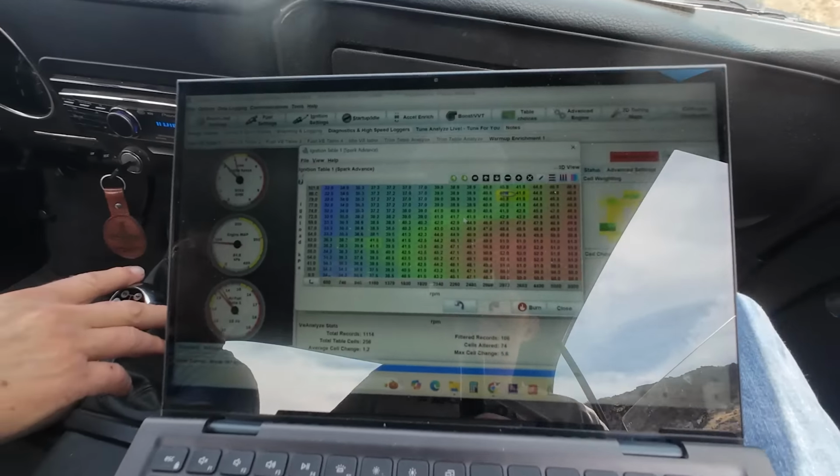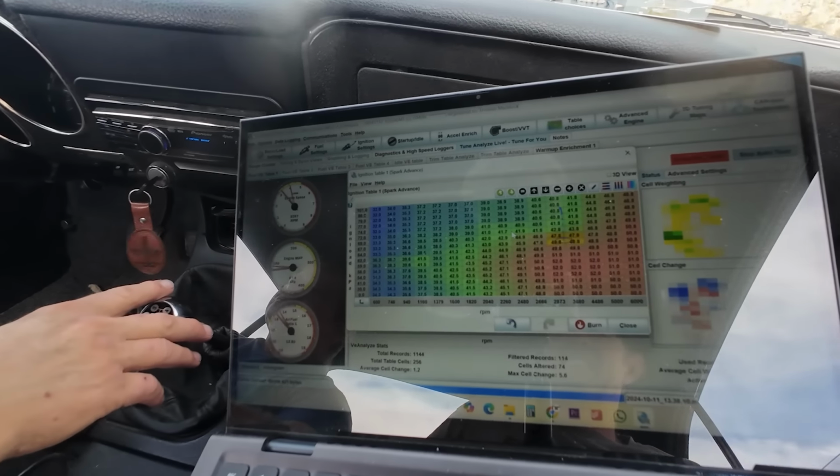Settings while we did that. Now we're going back up the hill again, and I'm going to watch the ignition this time. All right, we're back from all our cruising around. We made a bunch of adjustments. I didn't tweak the ignition because when we add enough fuel, the detonation went away. So I think we're going to be good.